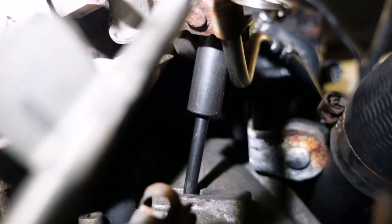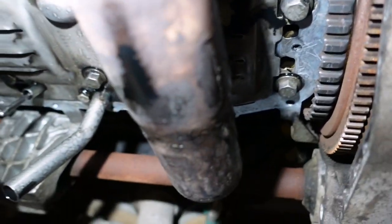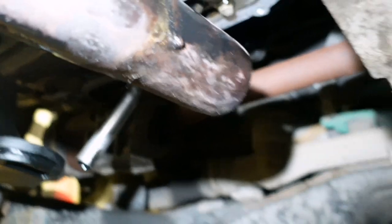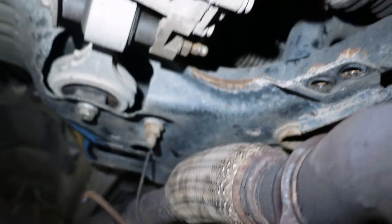The procedure says you have to take this DPF off, but you can get the sump off no problem with the pickup sitting there. I've just split the exhaust - there it is hanging there. The pin from the kit doesn't go between those pipes because there's a bit of an angle - it's not going to go in straight, so it's no good. But that's not the only reason why I'm not using that pin.